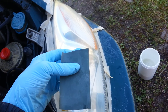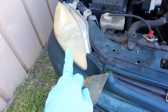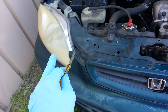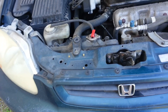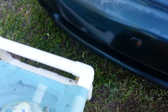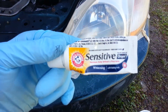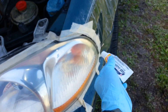Do that one time on this side, then when you wash it all off flip it over and use the other side of the sandpaper. I cut this in half so my other half I'm going to do the same exact thing on that headlight. So I've got two sets of clean sandpaper per headlight — about two dollars and fifty cents per headlight in sandpaper. Do the same technique on 2000 and 2500 grit.